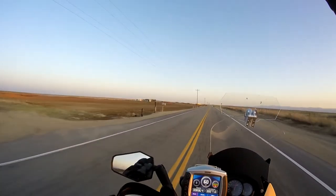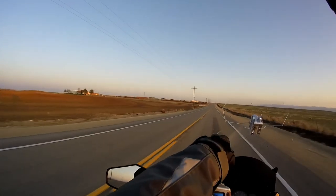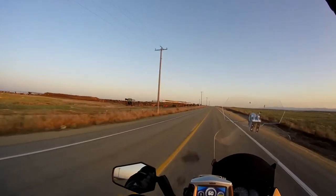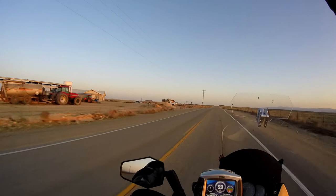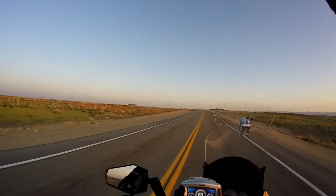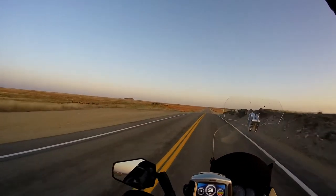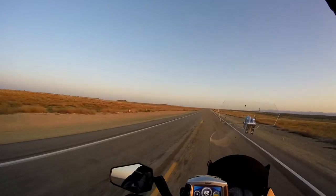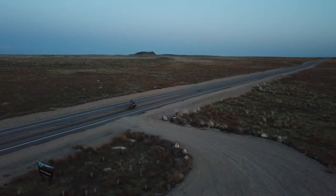It's raising the air up probably about six or seven inches. Previously it was just the Moose Racing windscreen — this is a Moose Racing Plus Four — and the air would hit me right on the top of the visor. You get a little bit of side wind and buffeting in there, and it was just enough to be annoying. So this is kicking it up another six or seven inches. I'm comfortably behind the windscreen now. I can ride with the modular helmet face open and around town without a bunch of wind in my face. Working great — first impressions on the clip-on windscreen are fantastic.